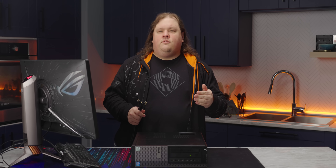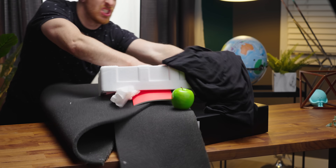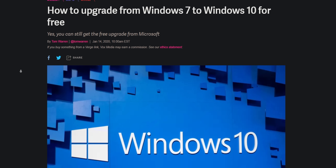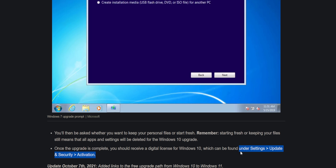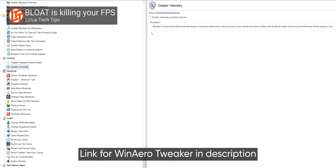Now let's set up our OS. We're not going to install Linux today. Moving to a Linux or FreeBSD based option does have both performance and feature benefits over Windows. However, if you're just starting out and you've got an old Windows based machine already around, this is the easiest way to get your foot in the door. If you want to see a followup where we use TrueNAS or similar, rattle your sabers in the comments. The first thing you're going to want to do is factory reset the PC. If you're running Windows 7 or 8, now is a good time to upgrade to Windows 10 or 11 — a lot of those old Windows keys will still work. Hit the Windows key and type reset, then click on Get Started and run through the prompts until you have a fresh Windows install. We ran WinAero Tweaker to disable automatic updates, kill Cortana, and disable a lot of the extra bloat like telemetry that can suck away valuable resources from an older system like this.